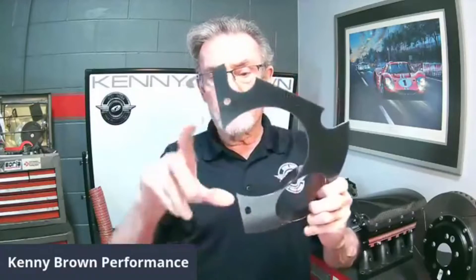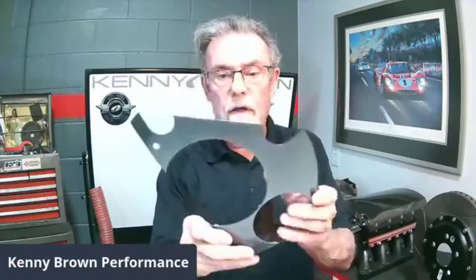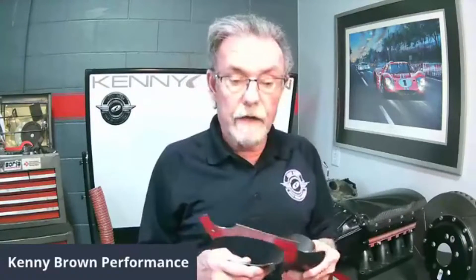This is the S197 design. This is the second design we came up with. This is the SN95 — it's actually a two-piece for the SN95s and you can see it's oval. Someone asked about a fox body converting brakes: if you've got a fox and you're converting, go to a '96 or newer SN95 spindle. The steering geometry is better and brake ducts fit better, so '96 and newer is the way to go.